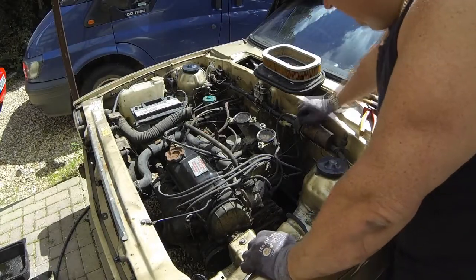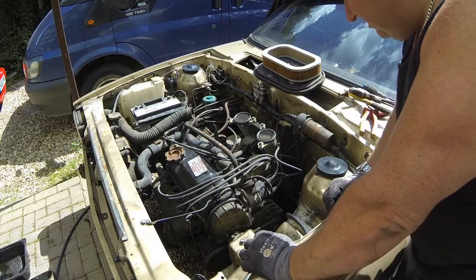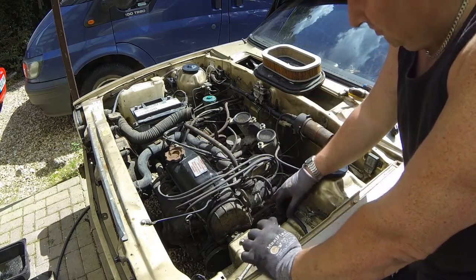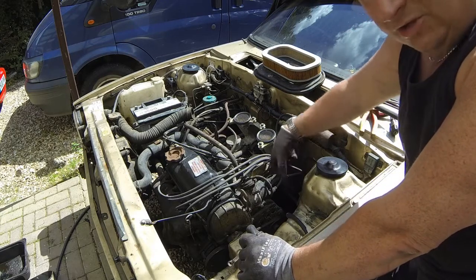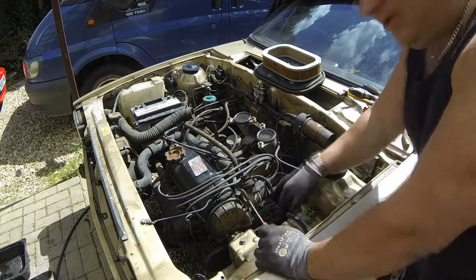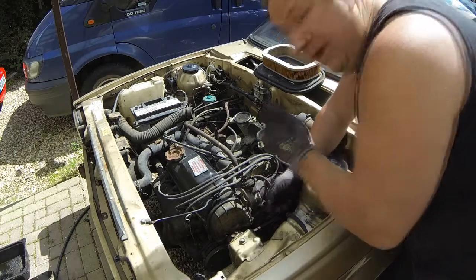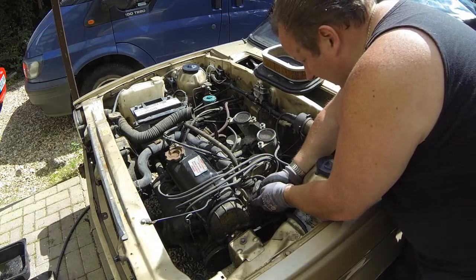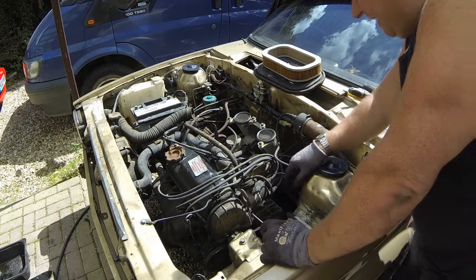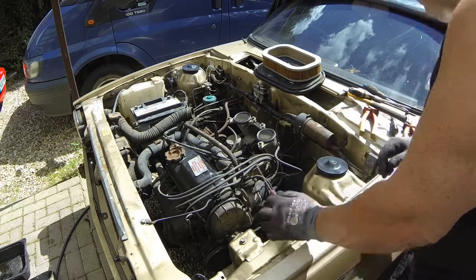Now that's given us a bit more room to work with. I've screwed the bolts back where they came from so you don't lose them - it just makes life a lot easier. Now I'm going to remove the HT leads - the spark plug leads - and also the distributor. These distributors rotate and that alters the actual timing of the engine, so it's got to go back in its correct location. What I've done is get a sharp object and scribed a little line in the aluminium head in direct line with the mark on the distributor, so I have a visual indication when I put it back in.